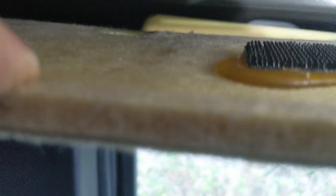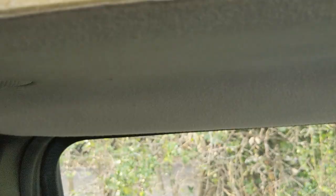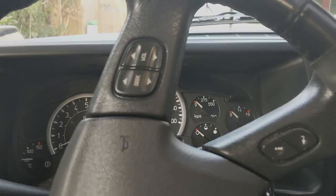It's now time to refit the new aspirator into position. The trick will be to align the little plastic dome's four lugs to the corresponding holes in the aspirator because you can't see. The new aspirator is in place — it literally just clipped into place. At the moment I'm not going to bother trying to bond it in place; I just want to make sure that it works and that the aircon is okay. So now we can put the roof lining back. The $64 million question is, does it work?